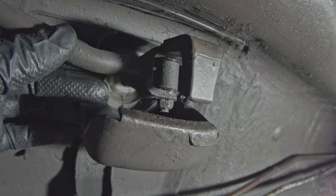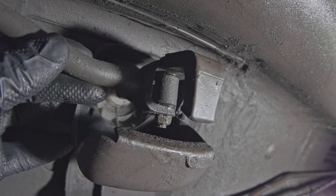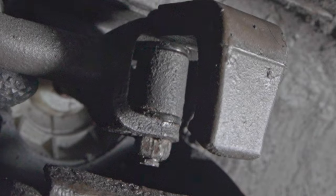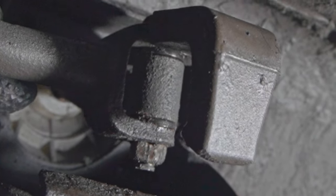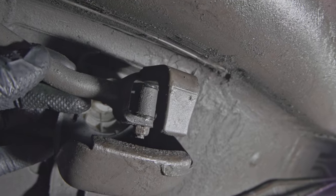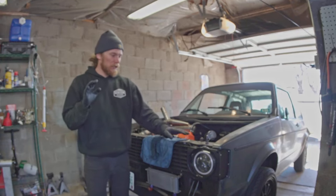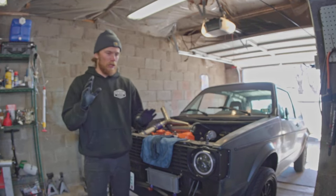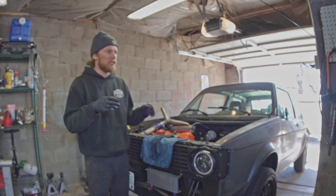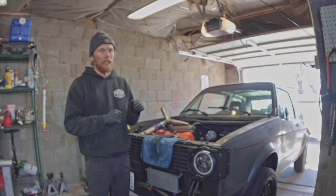I'm back under the car. New bushings are installed, and it's quite a bit better, but there's still a teeny bit of play. What I'm looking at is as I move this back and forth, I'm looking for that top shifter arm to be rocking a little bit in its seat, and it is ever so slightly, but it is much better than before. The real test here, I think, is going to be going for a drive, because that's really when the problem manifests itself — coming to a stop and trying to put it in first gear.